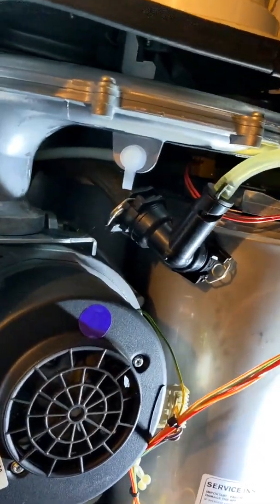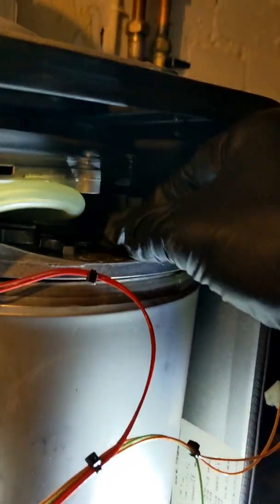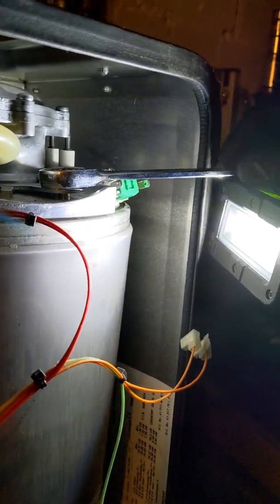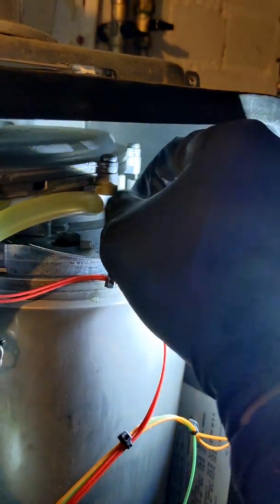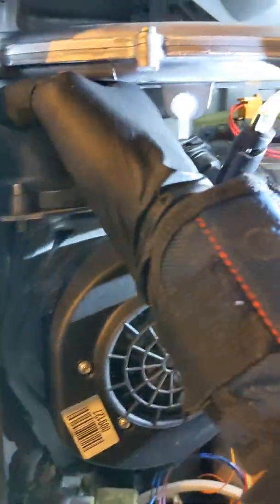Next we've got a 13mm nut on here which you just want to loosen up. That's basically connected to a clip which pushes the fan down and holds it in place. You want to take it off completely — it doesn't make any difference for removal, but when we put it back you want to keep it all together. That clip swings out, but for now we can just remove the whole thing. Grab the fan, give it a tug — it will swing and then come out the top of the heat exchanger; you just have to manoeuvre it a bit.